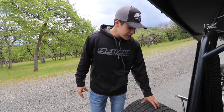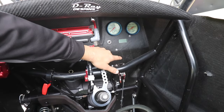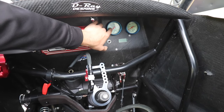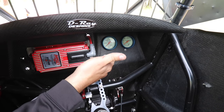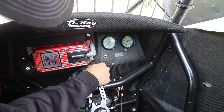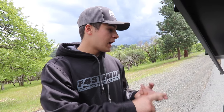For step number three, you're going to feel your tires skidding because the car's in gear, but once you get going they actually turn over. While that's happening, you want to look up and keep an eye on your oil pressure gauge — you should start seeing pressure. Once your tires have turned over, you're going fast enough, and you have oil pressure, you're going to flip the mag switch down. That switch gives everything power, so now you've got fuel and you've got power.